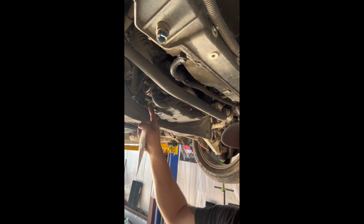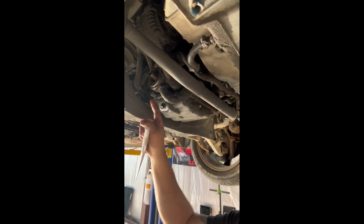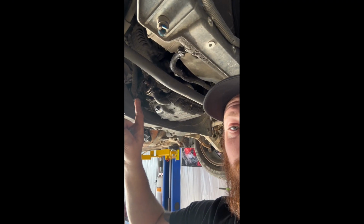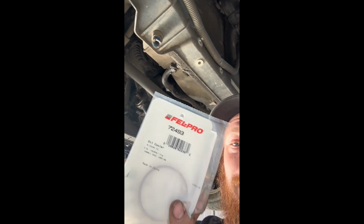No. So we're gonna have a Skidbilly tech tip of the day. If you own a 350Z, most G35 sedan or coupe, or I think also VQ powered Xterras, I've seen a lot of these oil coolers. The seal will develop a leak. Anyway, we basically just take those off. All you need is a 22 millimeter deep well socket. This bad boy, part number's in the description.